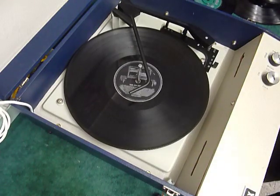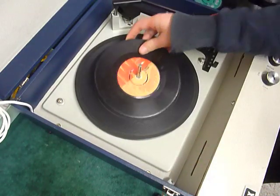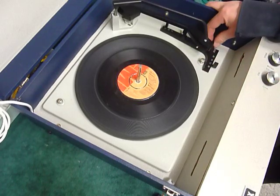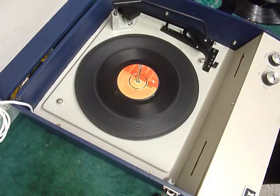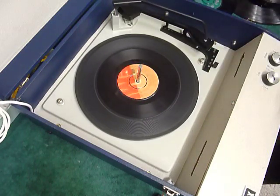If you don't want to use the auto-changer and just want to play one record manually, you can just place an individual record down the spindle onto the platter with the stack arm in the upright position. Select auto and the arm goes across automatically, or select manual start and place the arm onto the record yourself. Once the arm is on the record and it's playing, lower the stack bar down so it knows to switch off at the end of the record, or leave it in the upright position, which enables a repeat function and the record plays over again.